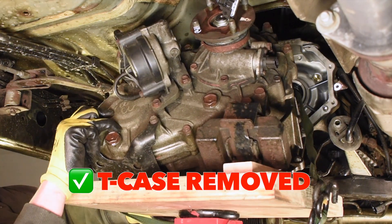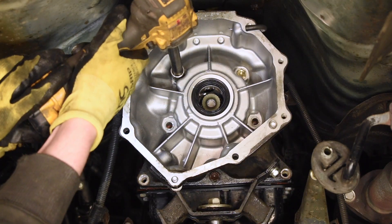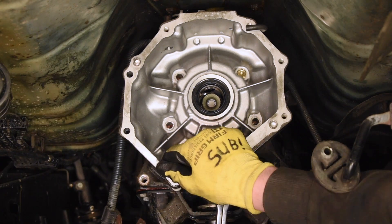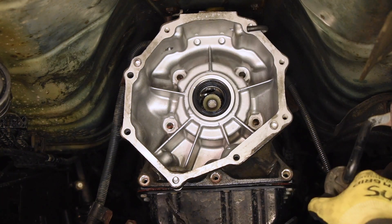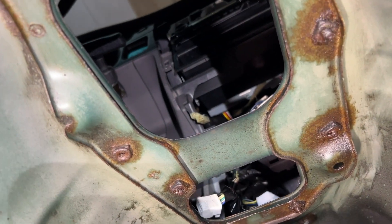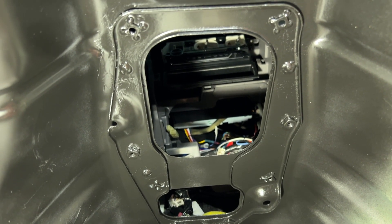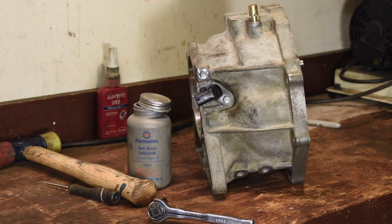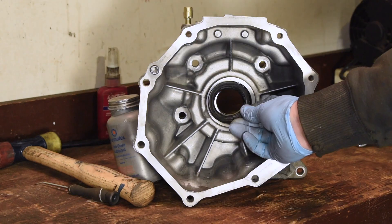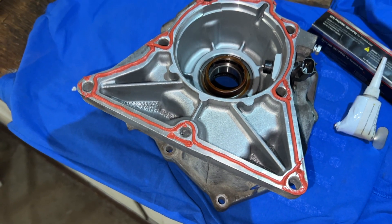Step one complete — T-case removed, just barely clearing the frame. Because I was a witness to the hack jobbery, I needed to remove the extension housing, transmission mount, and the transmission crossmember. Only a couple spot welds hold this mounting plate onto the body. I drilled out the spot welds, installed new weld nuts, treated the rust, applied a fresh coat of paint, and rewelded it in. I tend to fall into the camp of: while I have this part out, why don't I replace everything possible? I refreshed the extension housing with new fasteners, o-rings, and seals.